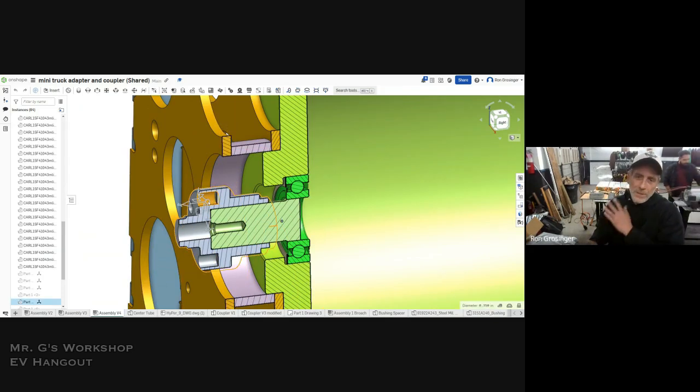And the coupler, we did something weird. We chopped it off. Dave, you got the crankshaft over there? Oh, I don't know where he went. Anyway, we took a crankshaft and we sliced it off. And then we actually took the end of the crankshaft, which is really what connects to your flywheel. And then we bored it and we broached it.